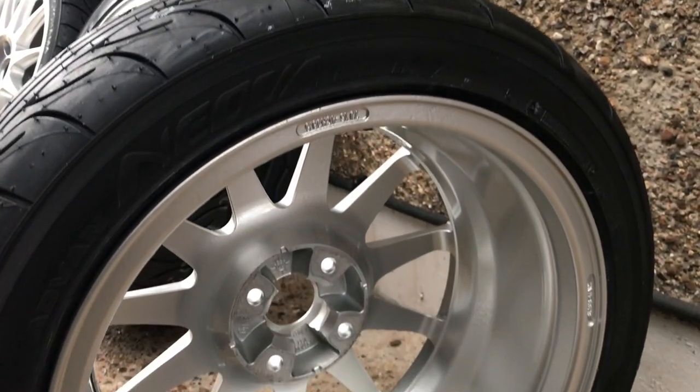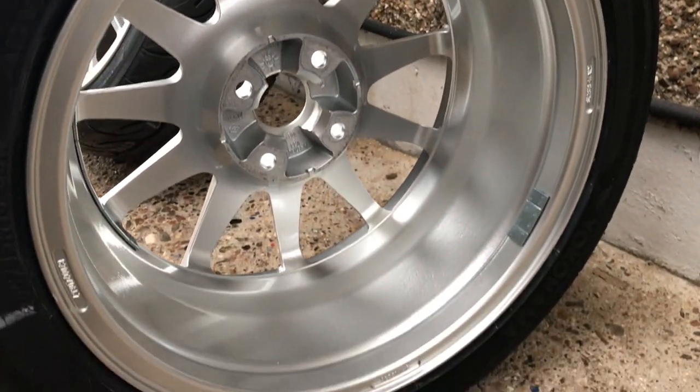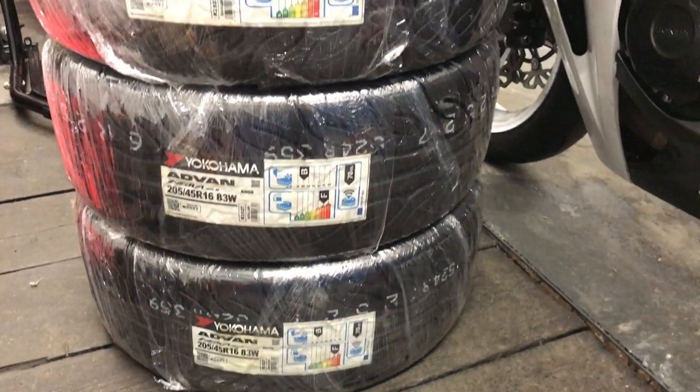There was a lot of corrosion on the wheels, and the other problem I was getting was losing pressure over the course of two or three weeks — the tyres would just slowly go down because where the bead is was just letting air back out past there. So it wasn't ideal, they didn't look great. We sent them away, took about four or five days, really quick turnaround.